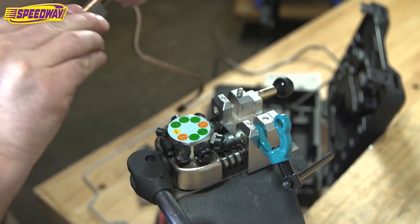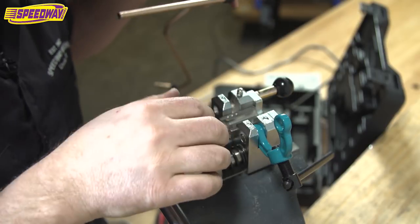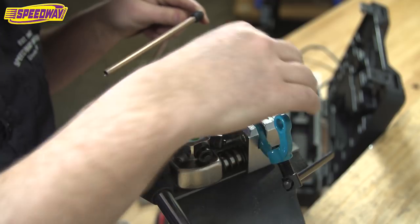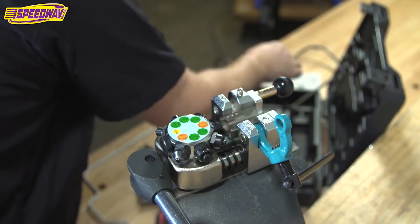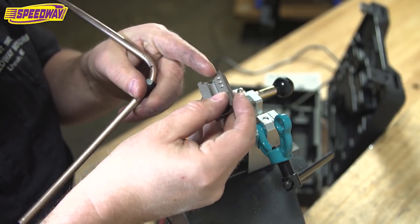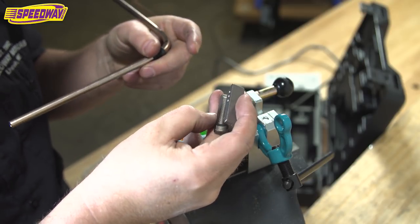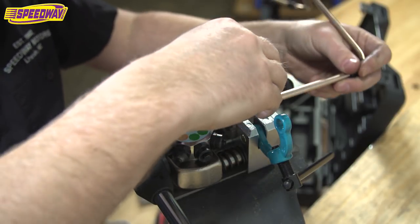So, like I did with the brake line, I'm going to slide this guy in. And again, I'm going to use the angled back. You can do just the other side if you're just doing a bubble flare, that's no problem. That does the job just fine for you. Nice thing is these are dimpled on the little dies, so you always know if you got the two ends matching each other, because you just put the dimples both the same side and you're good to go.